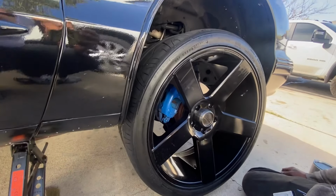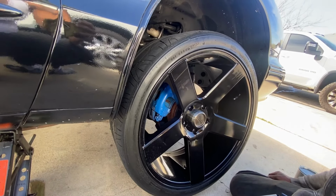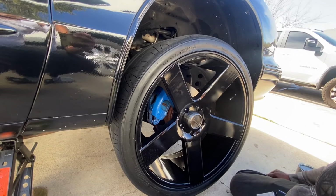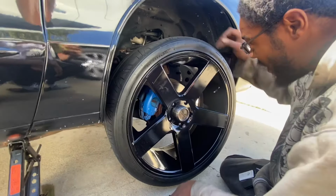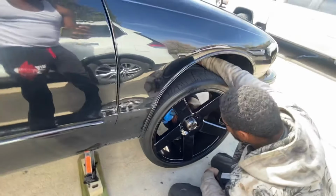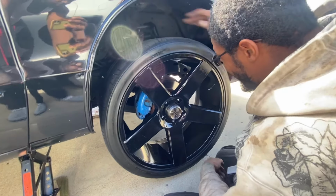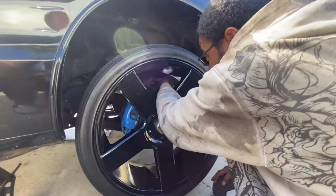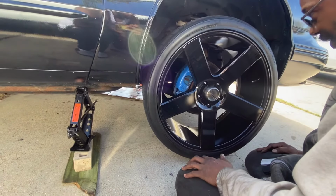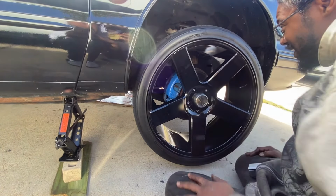I was just watching a video like 10 minutes ago, and they sell the control arm with the ball joint on it, not for this car, but you have the option. You can buy the one with the ball joint in it. It said it matters how it was put into the control arm: was it riveted or was it pressed in? These are screwed in. So you pop it and press it out, then press in and bolt it in.